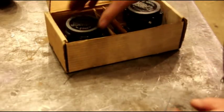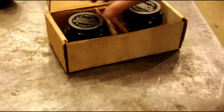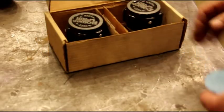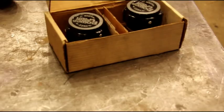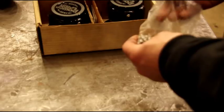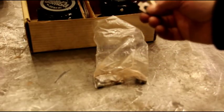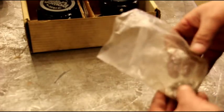They didn't come with any gaskets in the package so I made some gaskets. Don't be afraid to make gaskets when you need to — there's a lot of junk gaskets out there. This is some Garlock that I had, a real high-performance gasket material — it's a blue color and it'll hold up to anything. You can buy gaskets for these but the guys that sell them use vegetable fiber paper and they're very flimsy and don't hang in too good. So I made a couple gaskets this morning. A lot of times when you buy hubs you get these little tab locks — you put your bolt through and hammer the tab over the bolt. It's a single-use item and you have to change them every time you service your hubs.